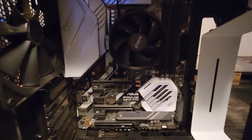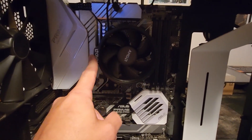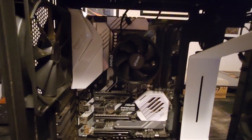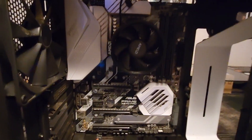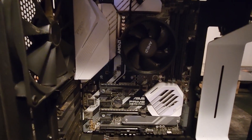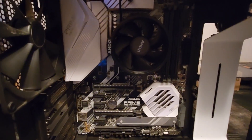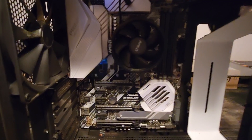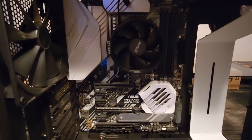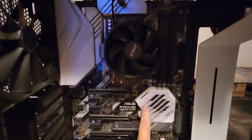If it causes thermal throttling then we can talk about replacing it. Now let's move on to the motherboard. With the 3600 I was always going to pair it with an X570, because in order to get PCIe Gen 4 on this CPU you needed at least an X570 or a B550 — a B450 wouldn't work because it doesn't have enough lanes. I did not know that going into this, so that was interesting — you learn something new every day when it comes to PC building.